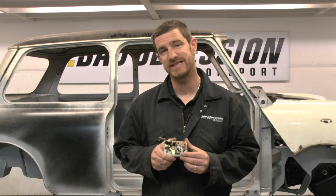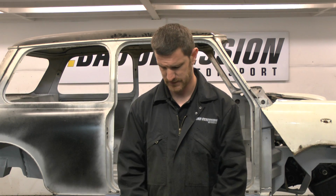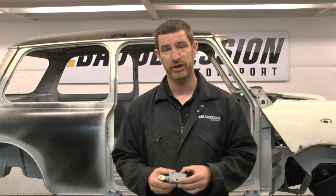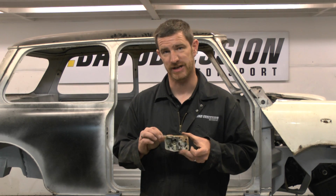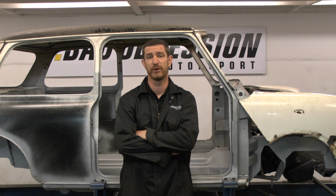On the Mini door catch, you need 10mm of travel to lock and unlock it. On the Mitsubishi door handle he's chosen, you need 15mm of travel to unlock and lock it. And on the central locking solenoid, you need 30mm of travel to lock and unlock it. But not only that, to open the mini door, you need to push the latch, and on every single other car in the world, you pull it. So all we've really got to do is solve all the different stroke lengths for all the different lock mechanisms, along with reversing the direction of the door opening lever. Oh, and we've got to fit it all inside a mini door, which isn't really big enough. So now you can see why Nick's having a nervous breakdown, and I've had a recurrence of my drinking problem.